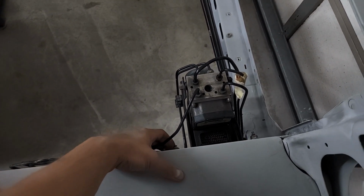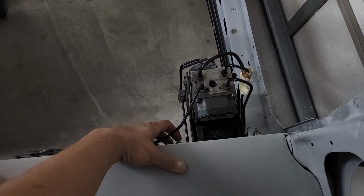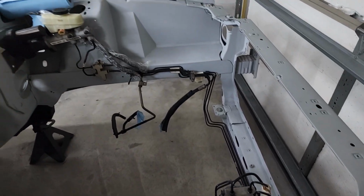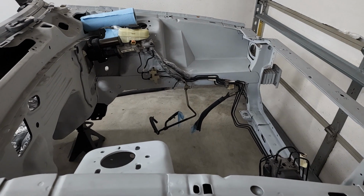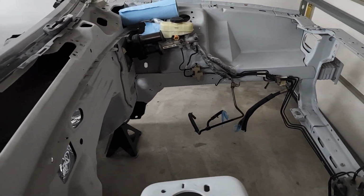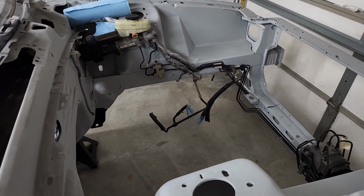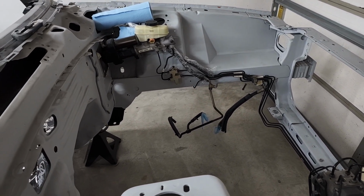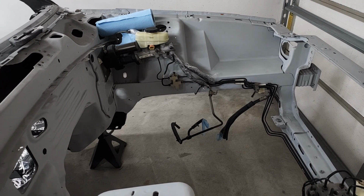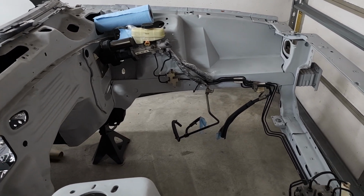Over here, I had to drill a slot in for the second stud to the ABS unit since the frame rail panels also covered it up. I wasn't going to run the ABS module, but over time, I decided to just keep it so I could directly swap everything over and have it plumbed like the factory did. If I do decide to delete it, I could still run an ABS block off plate, but I'm not really considering it anymore at this point.